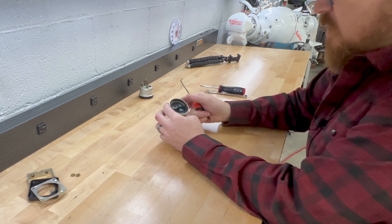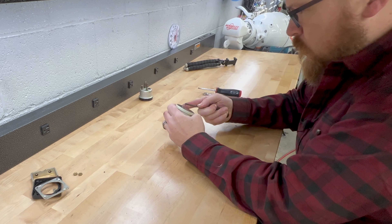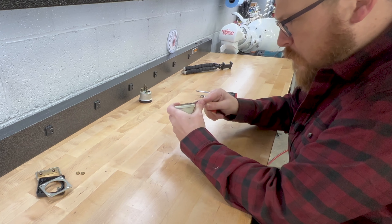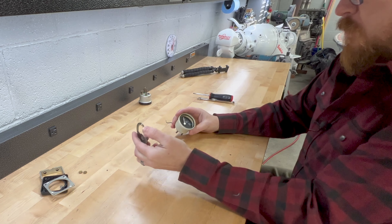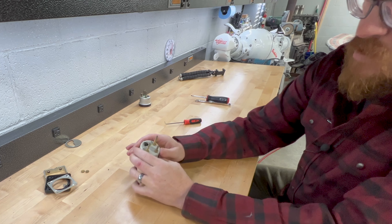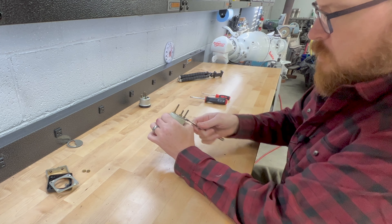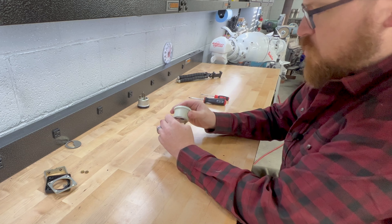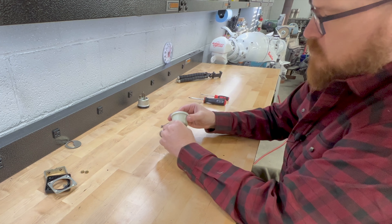I'm going to pop this lens out. It has the oil temp display on it. I should be able to unbolt the three studs that go to the terminals and push everything out through the front. Years ago on this boat I had some issues with the trim gauge — also a Medallion gauge — and while diagnosing it I actually ended up taking that gauge apart as well.